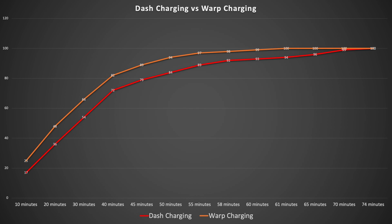Looking at the results, at the 10-minute mark there was a pretty big delta of about 9%, and that gap carried over until about the 40 to 45 minute mark. After that, the gap started to close up. Both phones have a pretty similar charging curve — it's just that the warp charge is a little bit faster. When it came down to the last couple of percent, the warp charger definitely slowed down and wasn't going as quickly as the dash charger. The overall result was a 13-minute difference in charging from 0 to 100% on the same phone with the same battery, just a different charger.